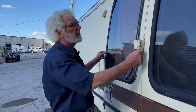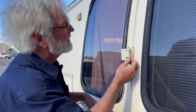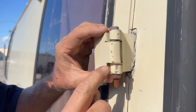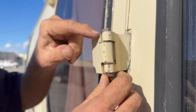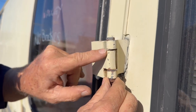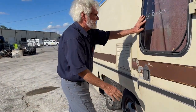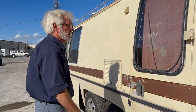The door — somebody's had problems in the past. Somebody put a washer in it and a bolt. The original bushings in here are plastic. The plastic bushings wear out and the whole hinge drops down. They tried to lift it up with this washer right here. You can get these pins and bushings — they make bronze oil-lite bushings now that you can replace these with. Most auto parts stores have it on the help wall. That door needs to be reset — it's dragging at the bottom because these hinges have dropped. Right now is the time to fix that.